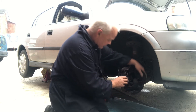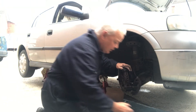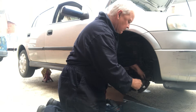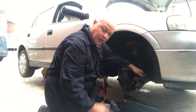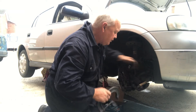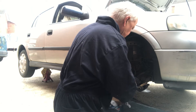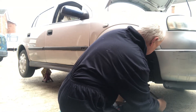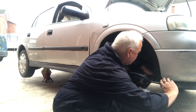Let's get the brake pads and clean all this up before we fit. Now we've got the caliper loose, we're going to take the brake disc pad out. We need to wind this caliper back. You can get special wind-back tools but I still resort to the old G-cramp with a bit of wood like this. Put it over like that and we're going to wind the caliper back using the G-cramp.